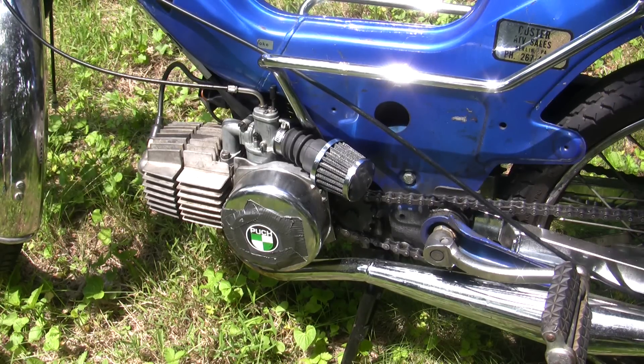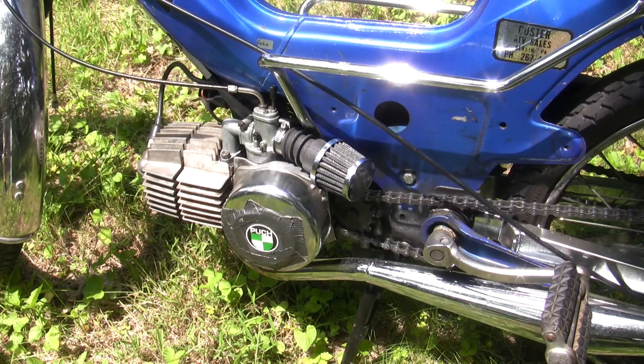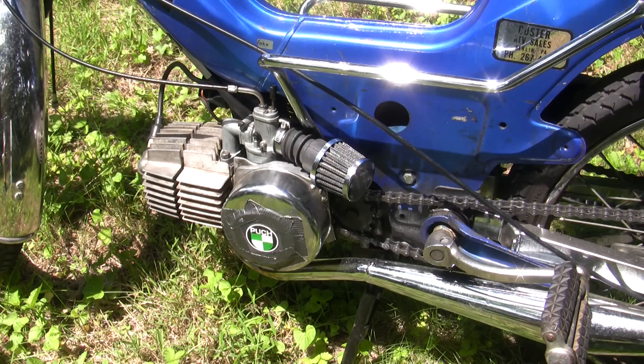In a nutshell, what I do is pick a jet that I know is going to be too big. I gauge that from looking at the tuner's spreadsheet and pick one or two sizes higher than what would be appropriate for my setup. I put it in, ride until I hear four-stroking, then down-jet and see if I still hear four-stroking. I down-jet again until I don't hear four-stroking anymore. Then I do a plug chop to make sure everything's kosher, which I'll show you in my next video.